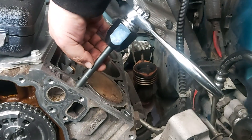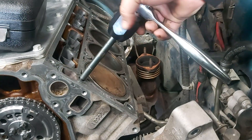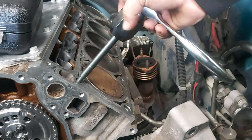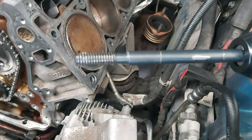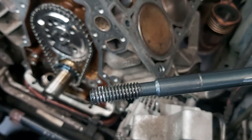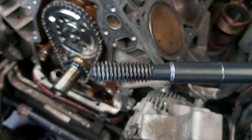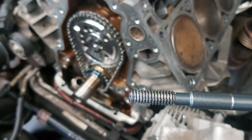It's sort of self-centering because the OD is a fraction off the size of that hole. So we'll get this out of here and see what came out on the cleaner. You can see the junk from the old head bolt that came out — it's the old Loctite that was on the bolt. That can cause your bolt to lock up early and then either snap it or rip the thread out.